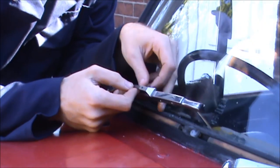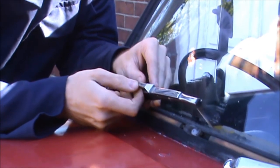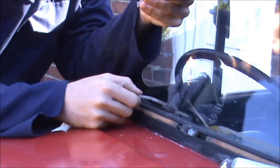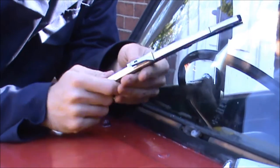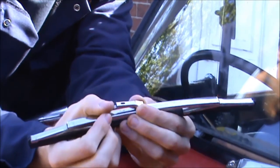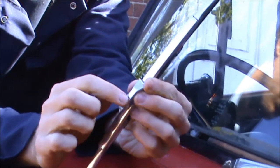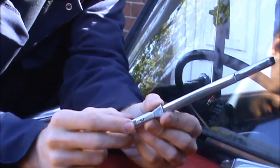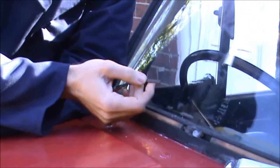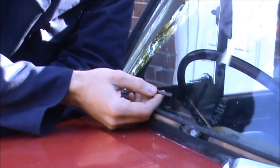There's a little catch on the underside of the stem, and if you press that down it releases it from the little cup that's in there, and it quite literally comes off like that. So that can now go in the scrap bin. There's a little lever here — you can just see me pushing it down with my thumb. There's a little hole there as well, and what is basically behind there is a little catch which goes into a recess in the wiper arm. Once you've released that catch, the blade will come off — it's incredibly simple.